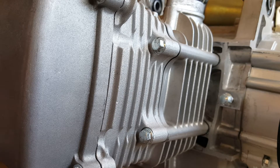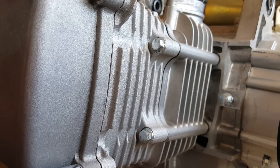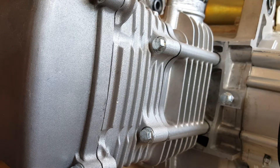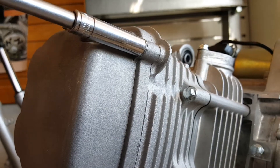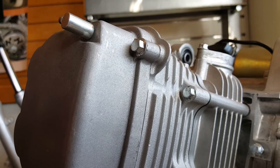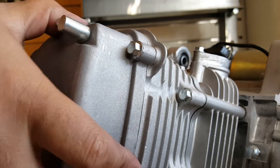So we're going to tighten all these down here. We got all the last screws — I did a star shape. Now I'm going to go ahead and use a torque wrench. Again, if you don't have a torque wrench it's not the biggest deal, but you can just keep it that way. So we're going to go ahead and torque it to specs here. There we go — all done. We're torquing it, I can hear it click. Sometimes your torque wrench won't make a noise but you can hear it — it just keeps rotating. That way you know it's already torqued to specs.